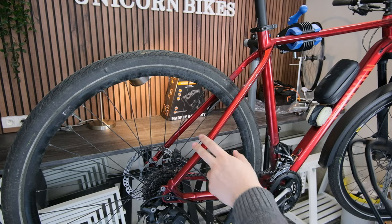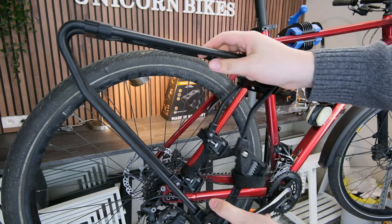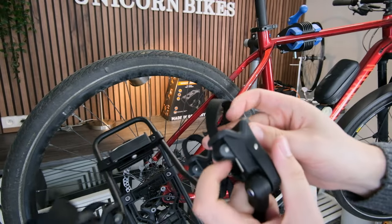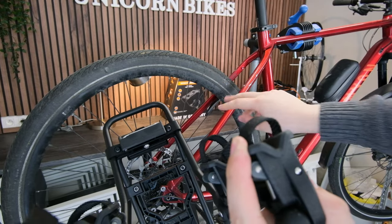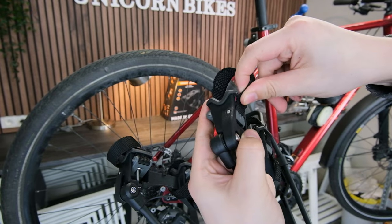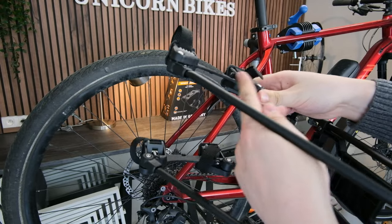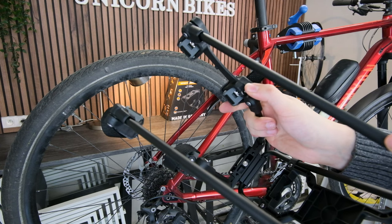So I took off the old fender and I'm going to start by installing the bike rack itself. The way it works is fairly simple — there's a rubberized strap and a rubber V that bites onto your seat stays. All you have to do is go around the frame, insert it in here — which is a little bit fiddly — pull it through, yank it, and then tighten up that T25 bolt and your bike rack combo will be installed.